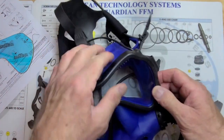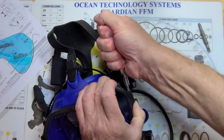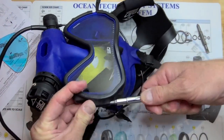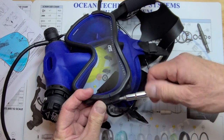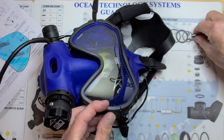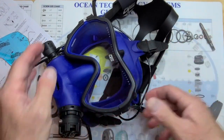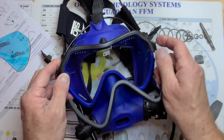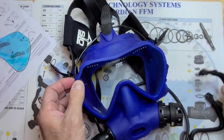On the other side, we're going to repeat the same procedure. I'm going to put my thumb under there and twist it around a little bit. Unscrew it until you feel that it's cleared the threads, then drop the screw out and set it down. On the other side, here the little nut is — set it down. Now once we get this off, we can remove the bottom frame and the top frame.